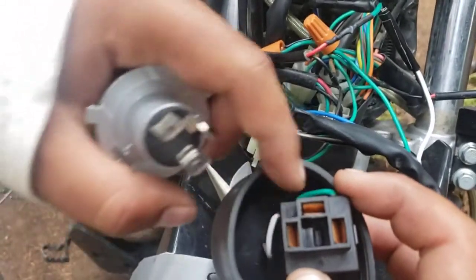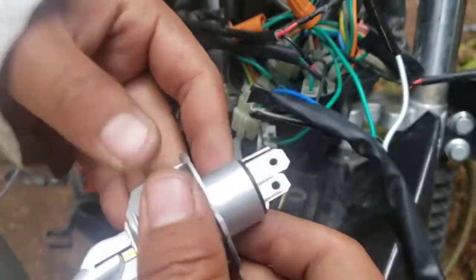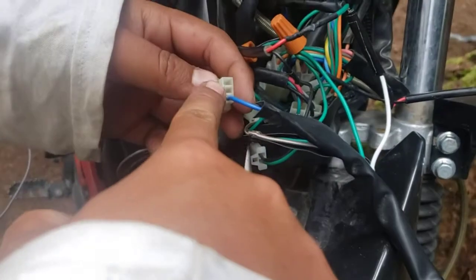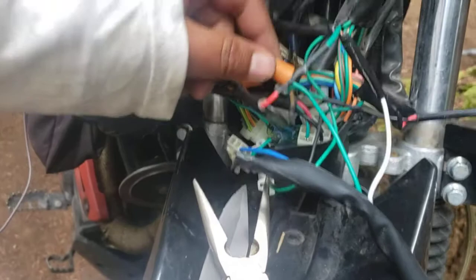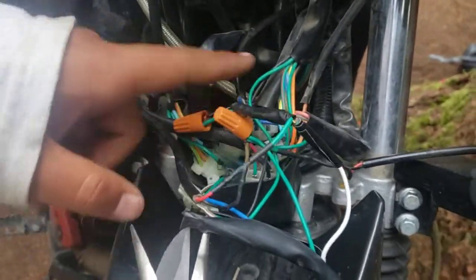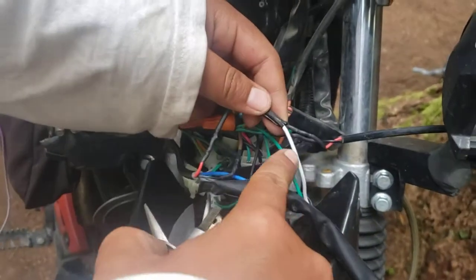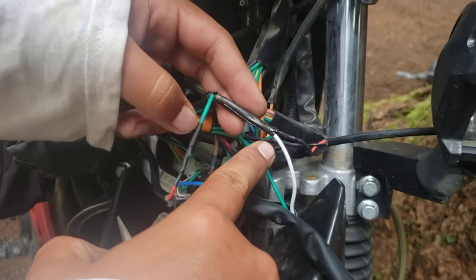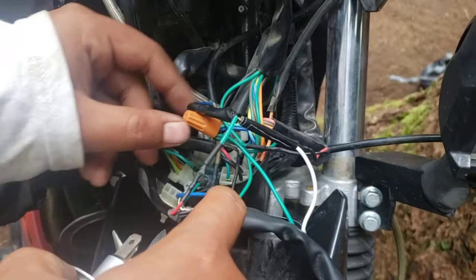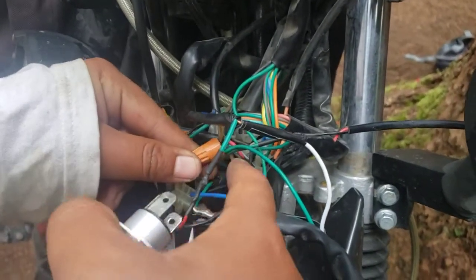We're figuring out which one is going into which. We don't need the high beam — it's too focused — so I took the low beam and the neutral wire out. With the previous fog light switch wiring job I did, I tapped the low beam positive line into the switch line of the fog lights, and just took the grounding wire into the grounding wire nut I have here.